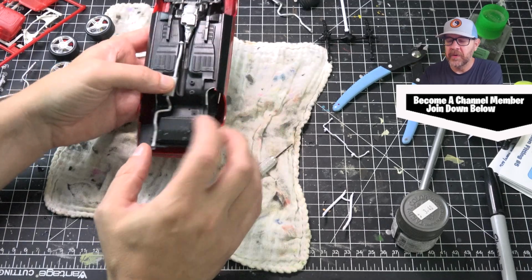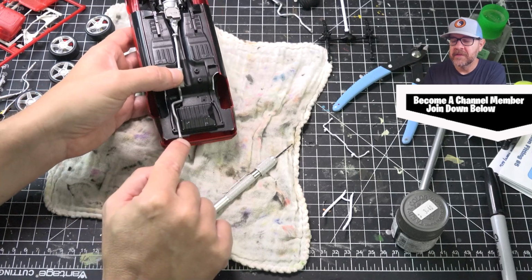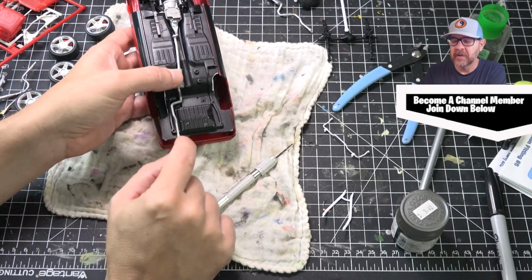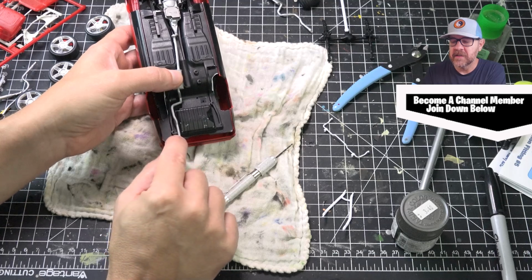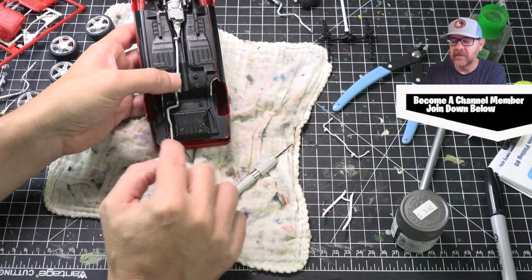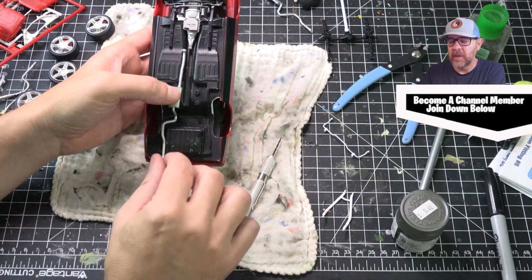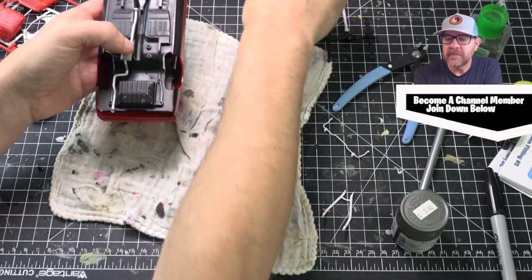And I don't know if I want to maybe put in a hanger back here on the tailpipe, just make a little hanger for it to make that connection. It squeezes in between the gas tank and the rear leaf spring goes right here, and it just kind of squeezes in there, but maybe we'll put a hanger in. But these mount up pretty nice.